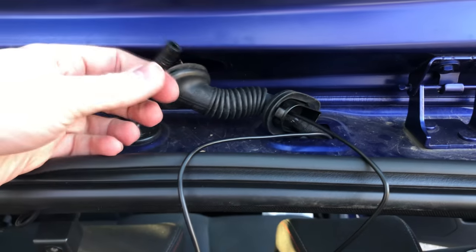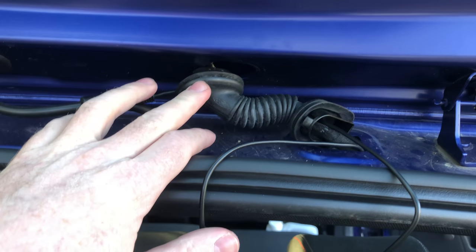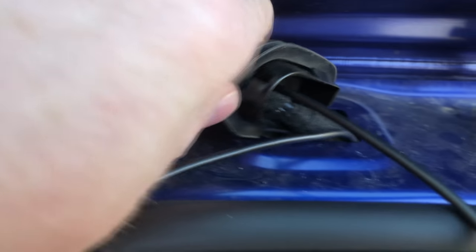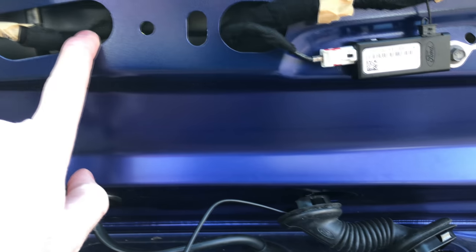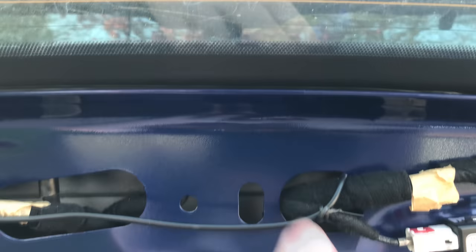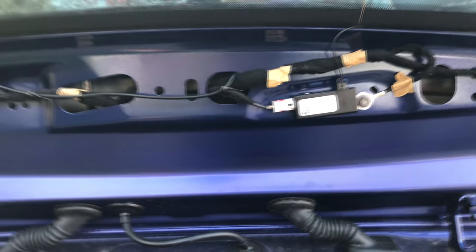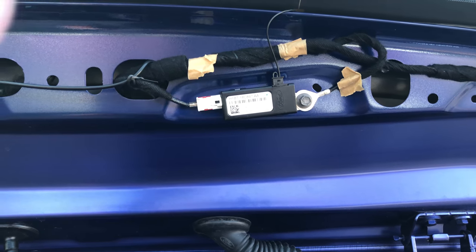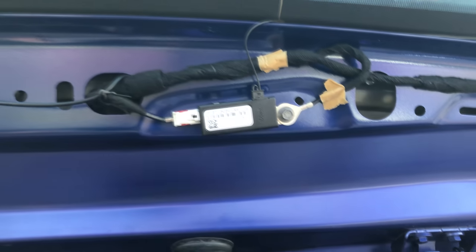Fitting this was quite difficult — it's unwieldy to get through the tube. To pop the trim out, remember on the top there's a latch to release first before yanking, and clips on the bottom and sides. Once you've got the cable through, pull it through and route it up from there. I managed to get the cable up from the grommet passthrough, routing it along the side to the camera area. One interesting thing: in the back of this car almost every piece of masking tape on the loom seems to be pre-ripped — curious.